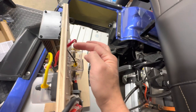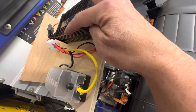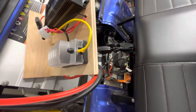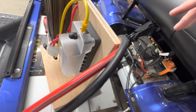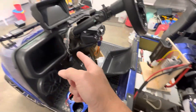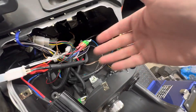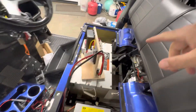I really like how this worked out. Basically, I got the line coming in from the rear, going through the board, and then going to the voltage reducer. That came with its own fuse, and then that goes in line into this fuse box. From now on, all I have to do is just tap into this fuse box for any additional accessories. One alternative would be to take your line out, run it under the cart, and create a fuse box in there. But that space is already such a spaghetti of wires, and I'm in the middle of doing some stereo work in there too, so I'll just put it here — it's a lot cleaner.